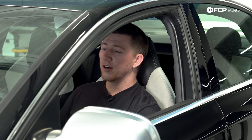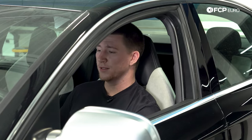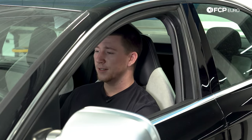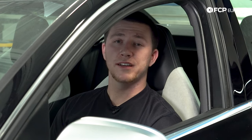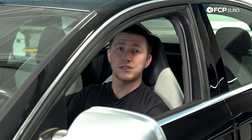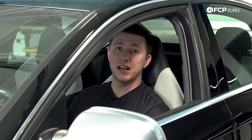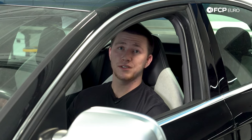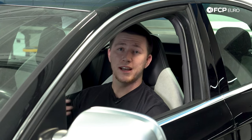Now turn the car ignition on and step on the brake pedal a few times to embed the brake pads. The front brakes are now installed on this 2013 Audi S4. We only showed the driver's side because it has the brake pad wear sensor, but remember the process is the same on the passenger side — the passenger side just does not have a brake pad wear sensor. Hope you liked this video; please hit the like button and leave any questions in the comments below.